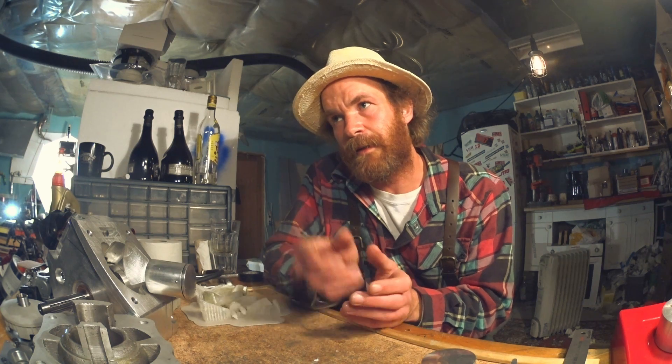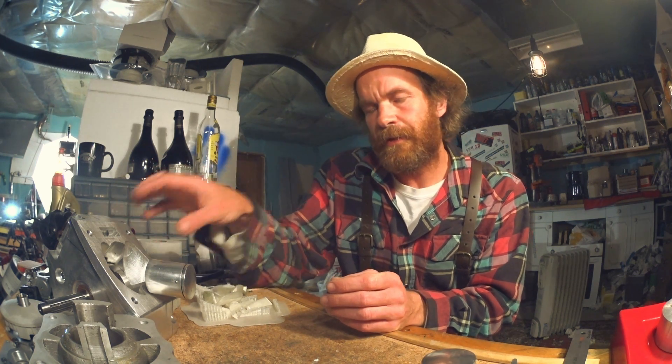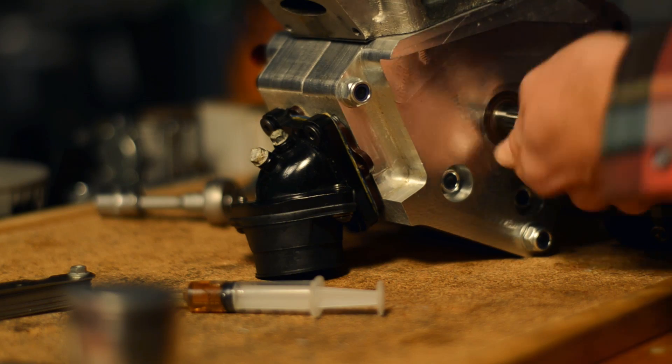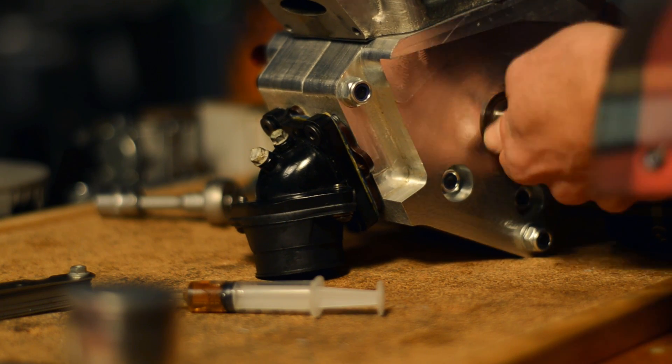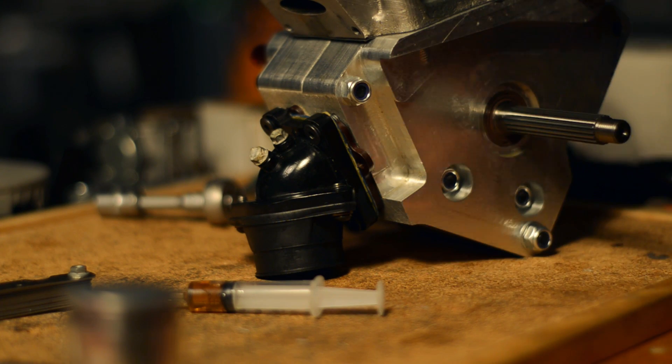It doesn't matter — I don't think I need any stuffers. If you remember my video when I ran the old SPX engine without the rotor valve, it started much easier than this engine does, I was able to rev it, and it didn't backfire. That much sound from the reeds — it's hard to imagine that the case volume is the problem. I really think it's the compression.